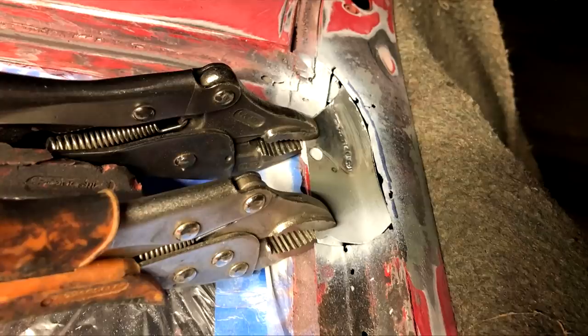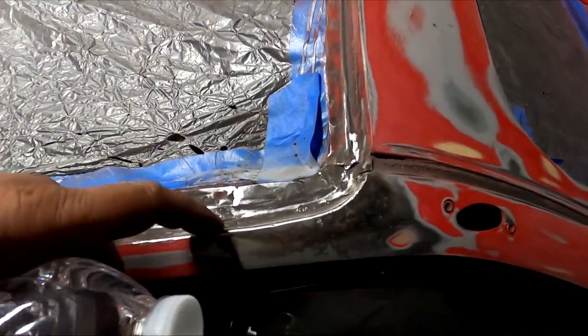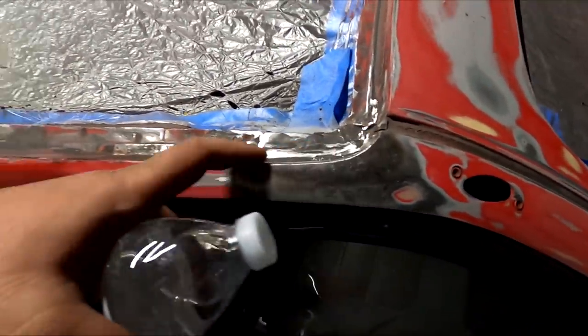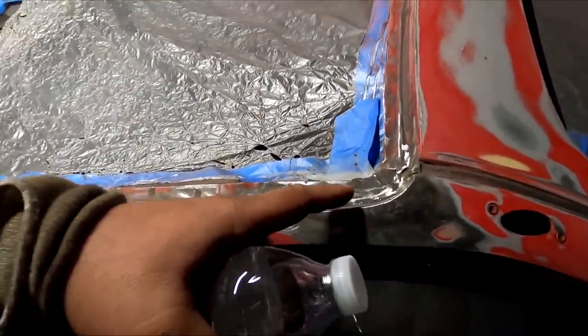Over here all boxed in as well. I had to cut and shape this out of the channel first, and once I got it nice and kind of perfect, put it in and weld it up. It was crazy because the material was eating out so bad that it was super thin — I kept blowing through. But I was able to get it all tacked in with the settings on three on the welder and got it all nicely sanded out in the contours we needed to fit the new windshield. All this right here is ready for filler work. Pretty much everything underneath has been zinc weld primed, so hopefully the underneath is not going to form rust anytime soon. It's cold with condensation — a lot of bare metal — but if surface rust forms tomorrow it's not a big deal, just surface rust. We'll sand it again, no big deal.